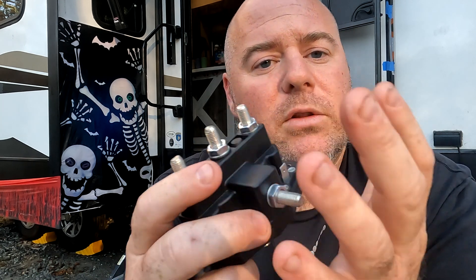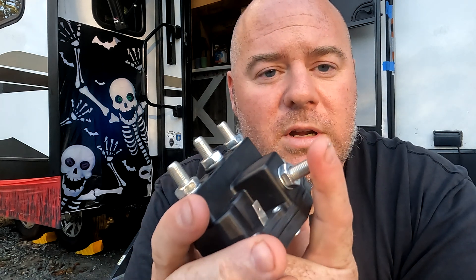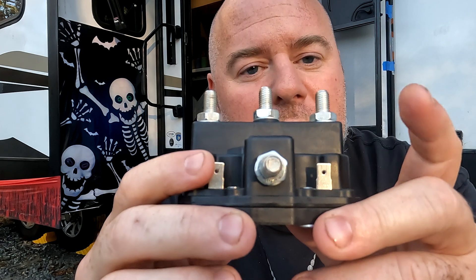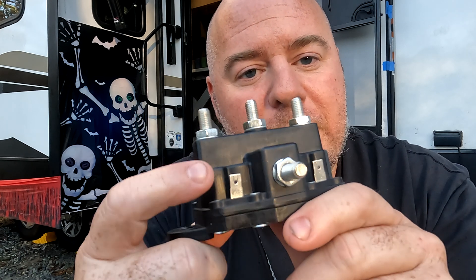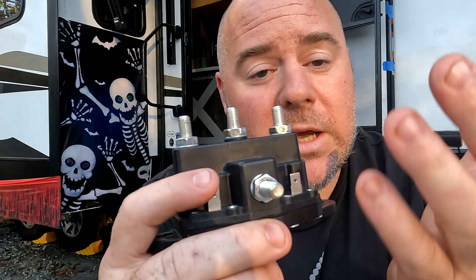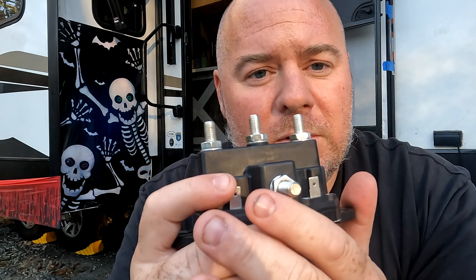It works off battery power. The very first thing you need to check is positive 12 volts coming from your battery — sometimes you have breaker problems, a dead battery, or a loose connection. Your center stud is going to be your positive power; just make sure you have a good solid 12 volts coming to it. Then check your negative — make sure you have a good solid ground, nothing's corroded, everything's good and tight. Next, make sure you have your signal wire inputs coming into either one of these switches. Put a test light with the wire hooked up, put your switch either up or down, and make sure you have 12 volts. If you do not have 12 volts coming to either one of these signal wires, then you have a signal issue problem — and that's going to be for another video.